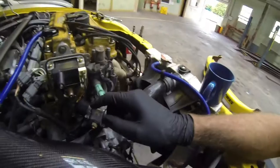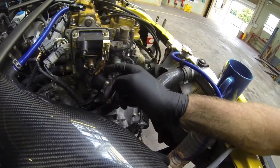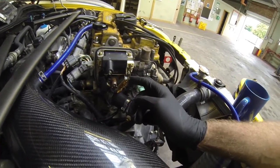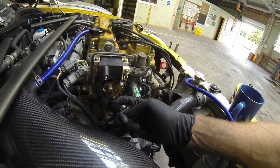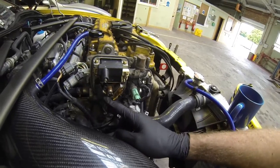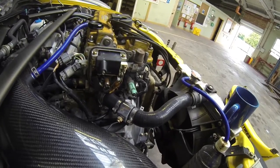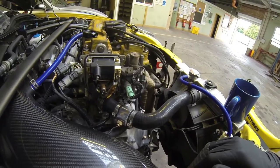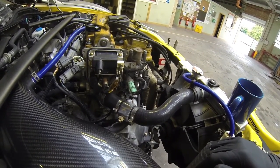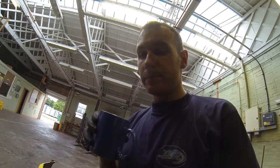Okay, so I see why they said to extend these wires - because they don't just come straight from there, they go through the PCM. They obviously go through that module and I think they get main power from the outside, but there's quite a few bits inside here. So I need to extend these wires - a bit of a bugger really, but I should be able to make it fairly neat so it doesn't look rubbish.